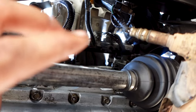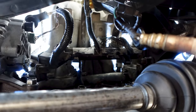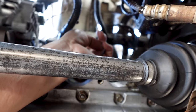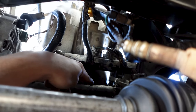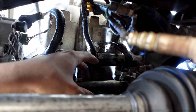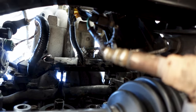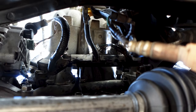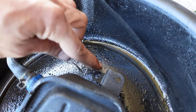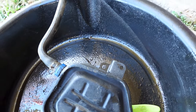I did remove the oil filter to give me more room to bring out the black breather box. On the wire harness I had to push it as far back as I could because of the water hose running in the back of the block — it's blocking the black box from coming all the way down since the box is kind of curved around it, built around it. One 10mm was right here and the other was in the back, so if you can find that tab and feel your way to that 10mm, that's probably going to be the easiest approach.